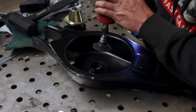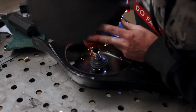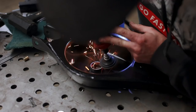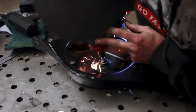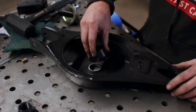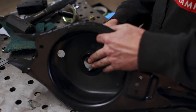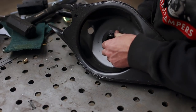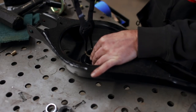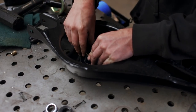To clearance the control arm, I'm using a flap wheel on the end of the die grinder. This end bit was definitely worth snagging — it's moved to the top of my must-have list. With the original spring seat locator buzzed down, these aluminum parts sandwich exactly as intended and leave just enough room for a circlip to hold them together. This circlip will keep the unit as a whole from moving as you adjust the spring from underneath the car.